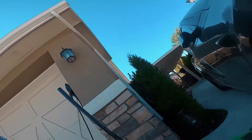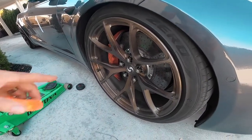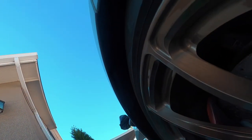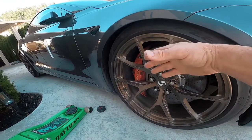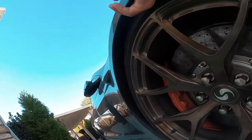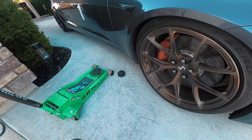Just for fun, I'm sitting at negative 3 degrees of camber. You can see how much it tucks in right now, because I usually run 305/35/20s on the track and these are 265/35/21s. With the negative 3-degree camber — the track setting — you get better handling and more contact patch from the 305, and it's also the only way to fit 305s in the front, because you have to have negative camber to clear. You can see how much of a difference in width there is.